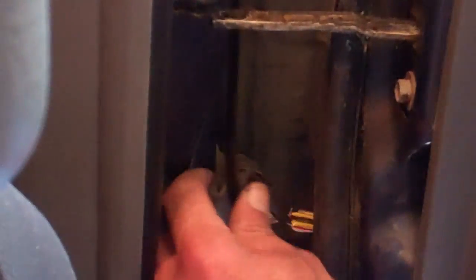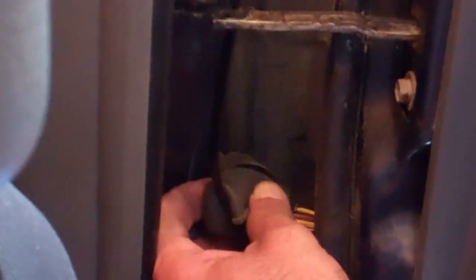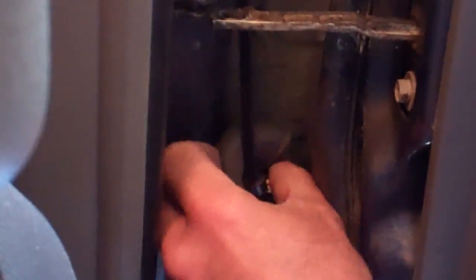So I put a tie wrap around in front of the boot because I want to keep those wires out while I cut them. I don't want them slipping in there and me missing an inch or so of wiring while I'm doing this. So now I'll take the big cutters, put them in there, and snip them off, leaving as much wire as possible for me to play with. And again, like I say, not recommending any of this, but if you're doing it, you're definitely going to make sure that you've disabled all the electricity to everything here.